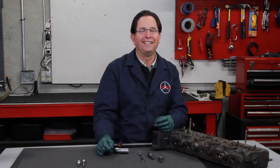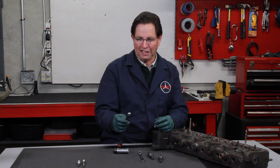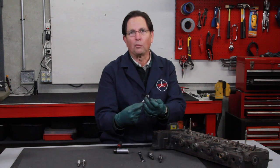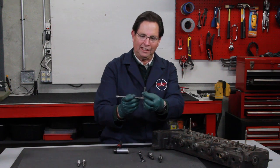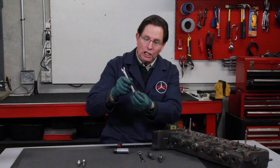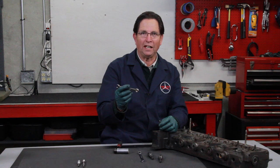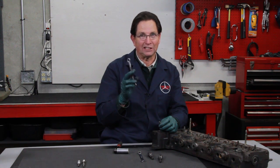So one day I said I'm going to make a special little wrench. This one's not rocket science but let me tell you, it works. I took a 12 millimeter box end wrench, straightened it out, and welded a little tab on one side. Now I can put this box end on the head of the reamer — look at that, it doesn't fall through — and of course when it's in the head you can push in and turn it. This little wrench has been very successful; we carry these on our website. If you have an engine with pencil glow plugs, I highly recommend you pick this up.